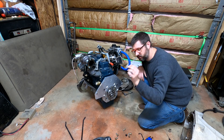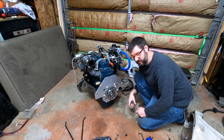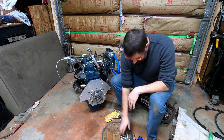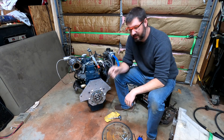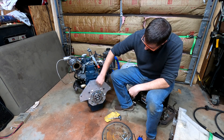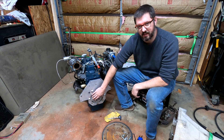I'm going to have to get longer bolts because the plate is now wider than the original adapter plate. I went through my bucket of bolts and I think I found all the right ones — five matching and one that doesn't match, but they're the right length and the right pitch so it should work. Now we're going to finish installing all the fasteners and then attach the flex plate to the crankshaft adapter as well.